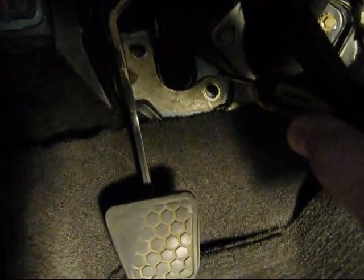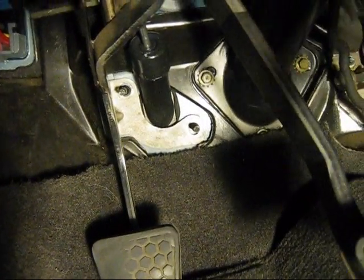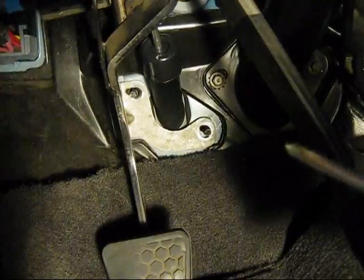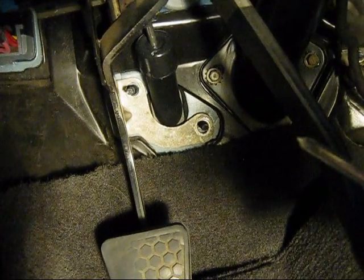See, it is connected. Be careful because it is kind of difficult to get it off sometimes. One time I was pushing really hard on it and it popped off and just disappeared — I had no idea where it went. I ripped apart all my interior and it was stuck up in some wires I could not see. When you remove the two 13mm nuts holding the master cylinder to the firewall, if you haven't taken it off before, there were probably star washers on there. You can just cut them off with pliers — you don't need them when you reinstall.